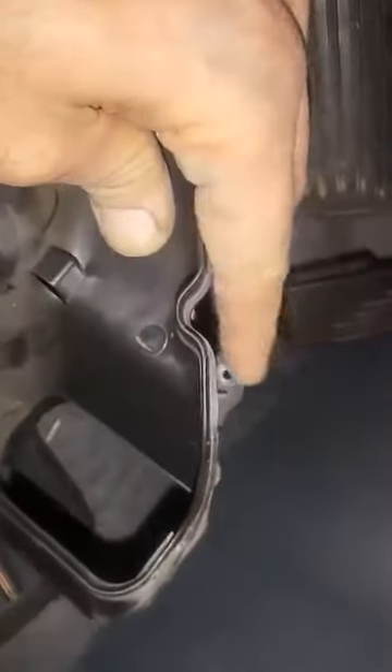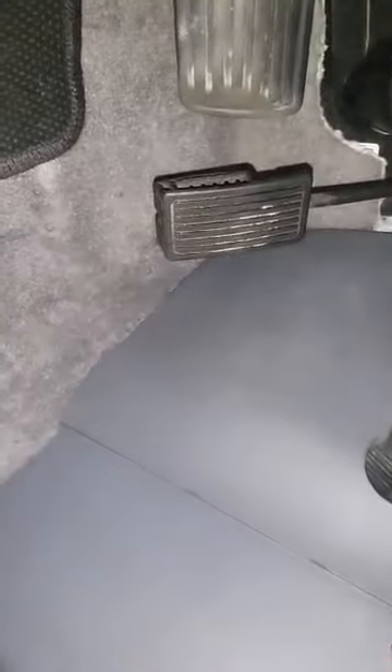The door blend actuator is right here. Go down on the driver's side — you're gonna have to disassemble this with three 7mm bolts. There is one over here, one on top right here, and two more 7mm bolts. To get this bolt off, it's better to unclip this one so you can get the top bolt off — or you can try without breaking this clip.